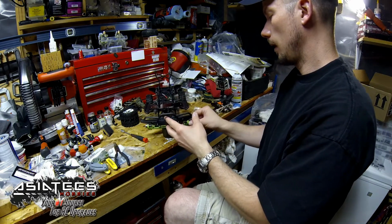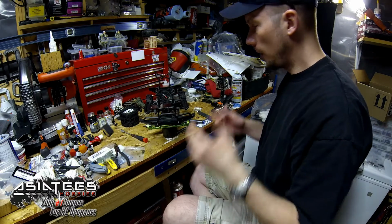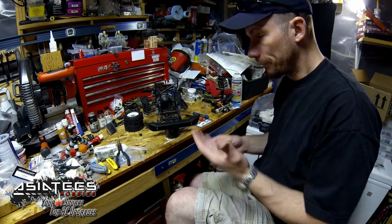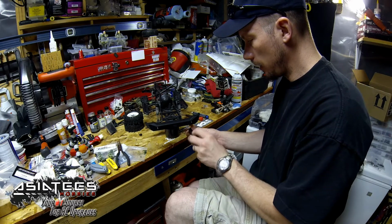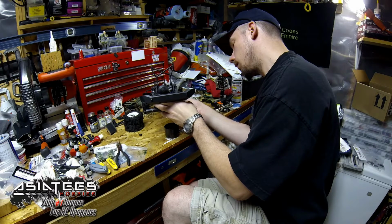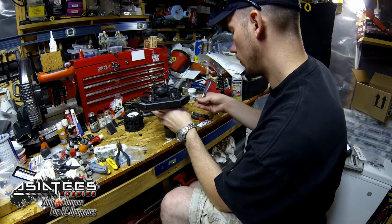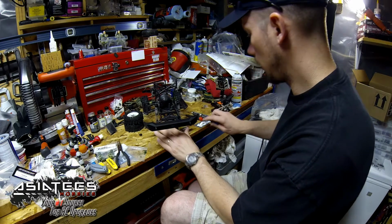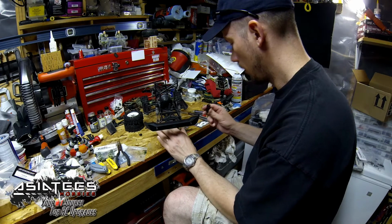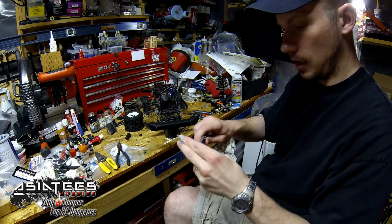Let me get the rear tires off. It's the same concept on the rear, except it's just straight up lockouts. I'll get the tires off here real quick and we'll be right back. Okay, so let's get in the back half and get these swapped out and our rear lockouts installed. Remember, on these you're going to reuse your stock screws. So it's important to be careful, don't over tighten. We're just going to pop that out. Cool, our bearing stayed on there. There's our old lockout. Here's our new lockouts.